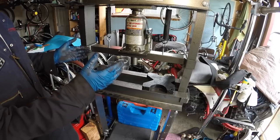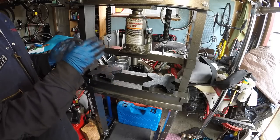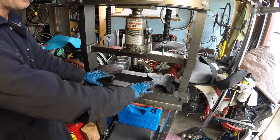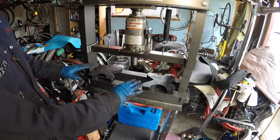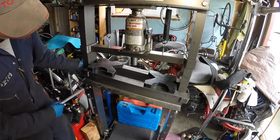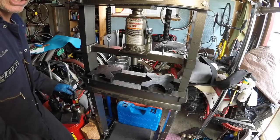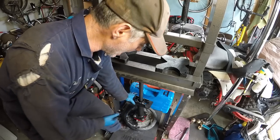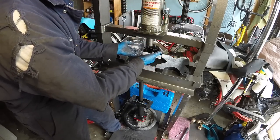The press comes with two plates, so you don't have to buy those separately. We currently have the crossmember at the highest position with the pins in the uppermost holes. The next step is to slide the axle assembly underneath the arms, oriented so that when we lower the crossmember down, the tool will fit between it. If you're by yourself it's trickier — you'll have to slowly see-saw it down. Ideally, you have a friend helping.